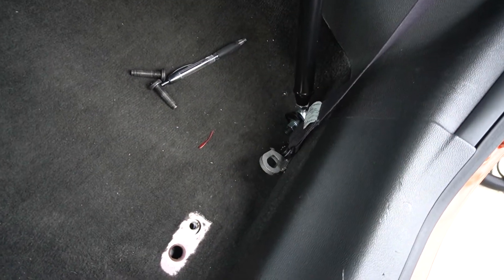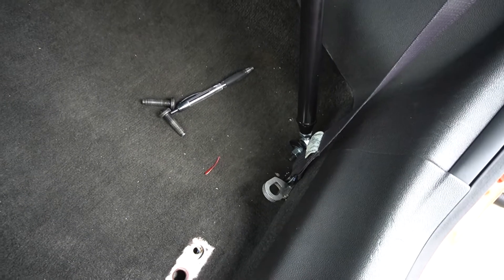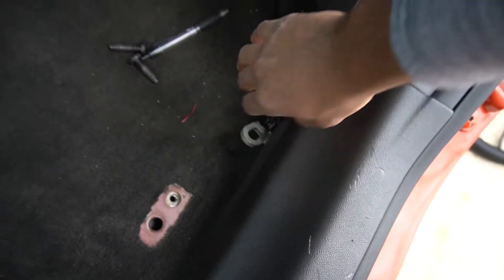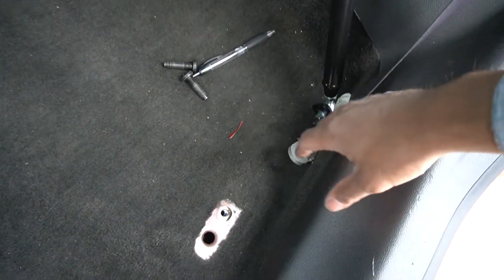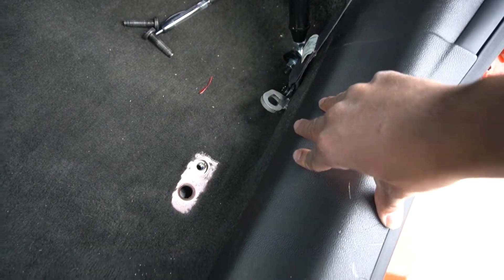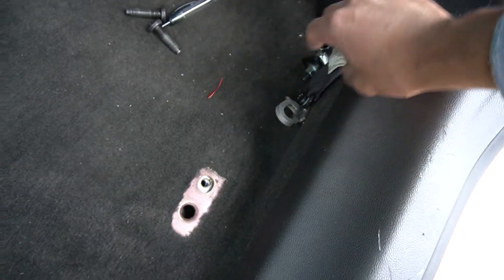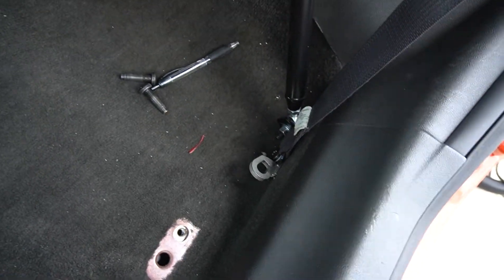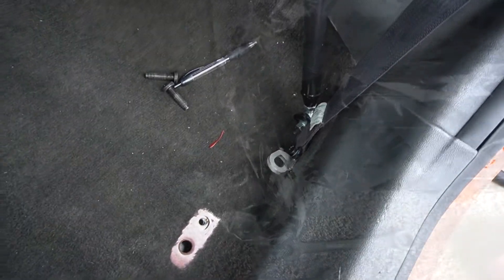I don't know if that's how it's intended to be used — not a professional, use at your own risk. Link will be in the description. It's easier to do this without the seats in, and I did all the bar and harness work at once. But if your seat is already in and you want to use a factory seat with a harness, you just have to take off your bottom seatbelt bolt with a T-50 and throw the anchor piece in there.